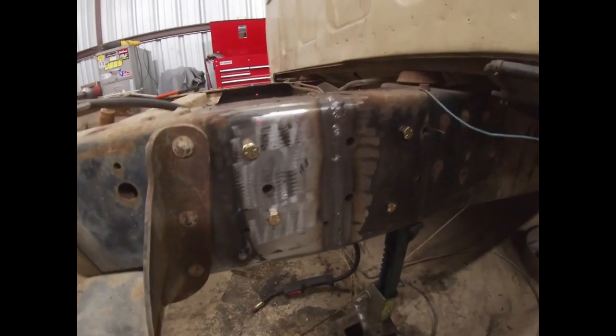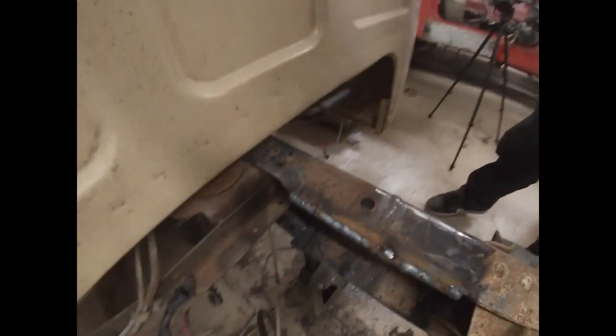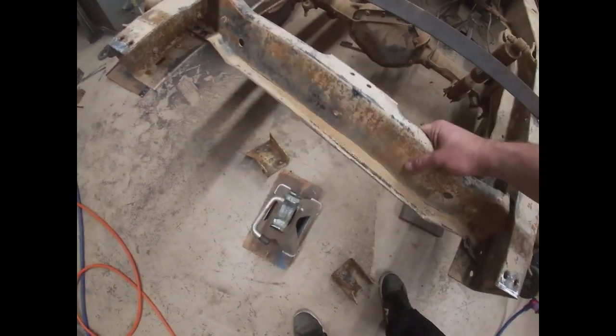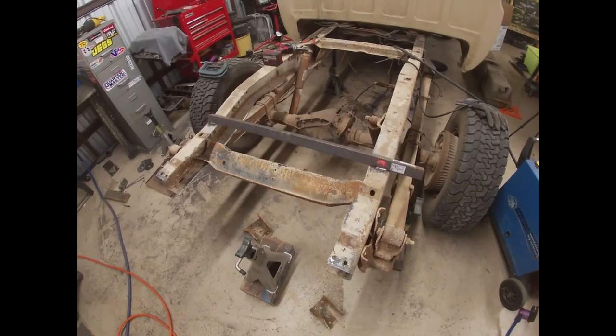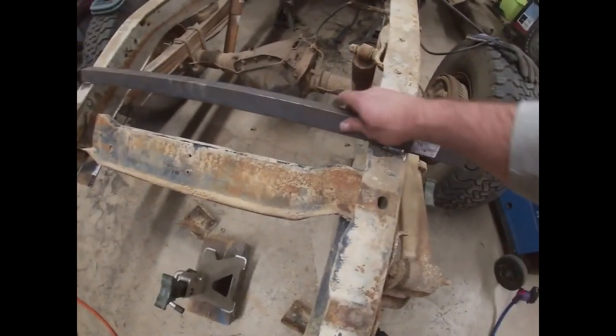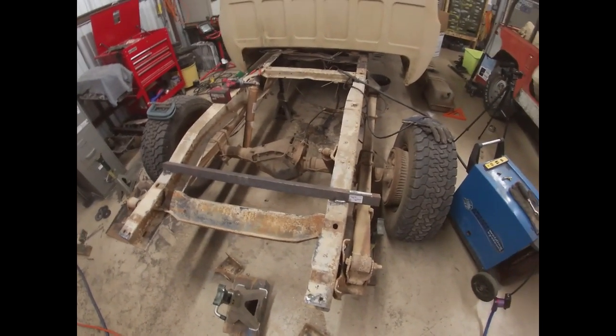Got some bolts in there, got my plate on the inside, got it all welded up. The bolts are a little bit too short so I'm gonna have to get some longer ones and put them in tomorrow. Got the six inches cut off the back of the frame on both sides, got the brace out. I'm gonna be making some modifications to the suspension so I'm not gonna bolt that back in right now - we'll wait and do it all at the same time. Whenever you take this brace out for any reason, always make sure you brace it with something because these frame rails back here turn into wet spaghetti when you take them out and then everything gets all mixed up.